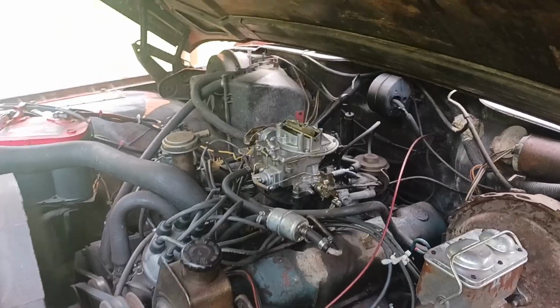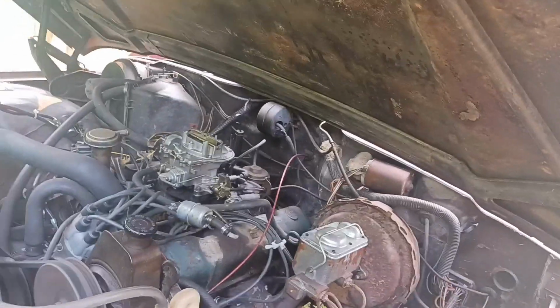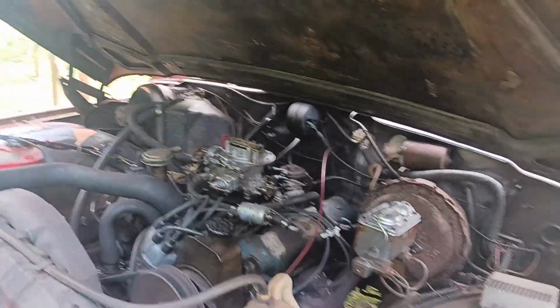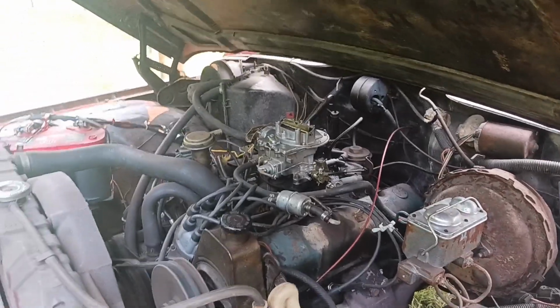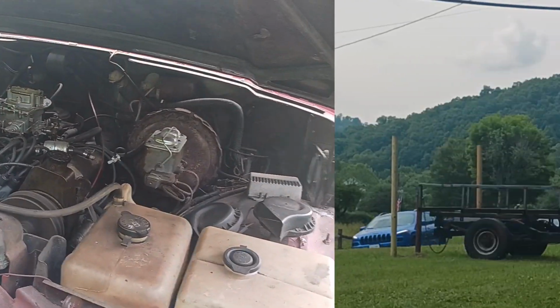Yeah, I guess that 16 to 1 two-stroke oil I filled the bowls with kind of fouled the plugs out. Made it run a little rich. The bit I spilled down the throat kind of flooded on me. Let her sit about 10-15 minutes, gave her a little shot of starting fluid, and she started up. So, nothing like a self-induced problem.